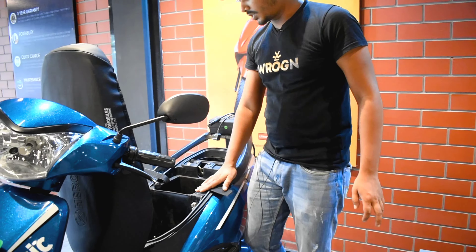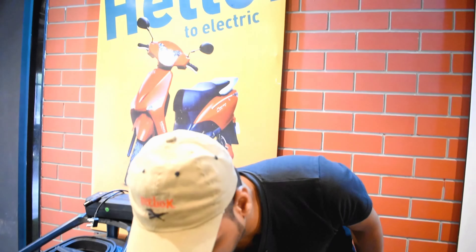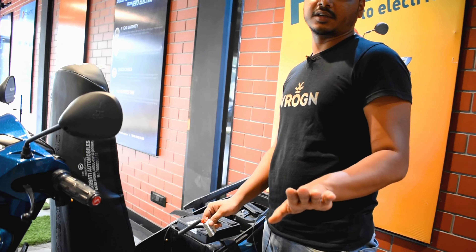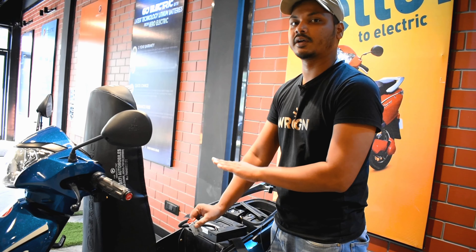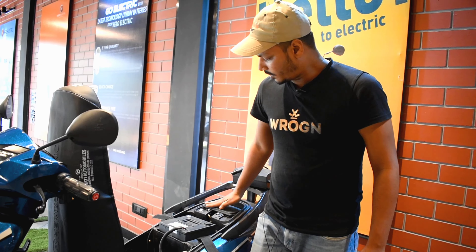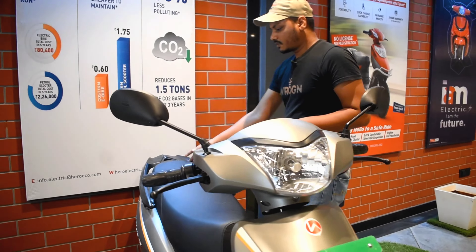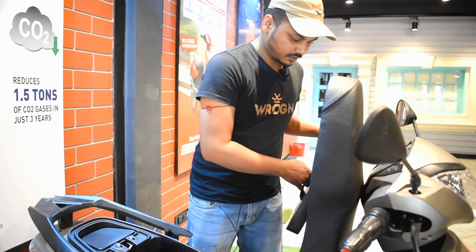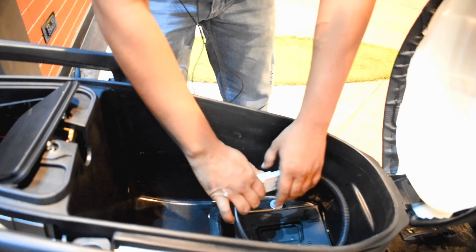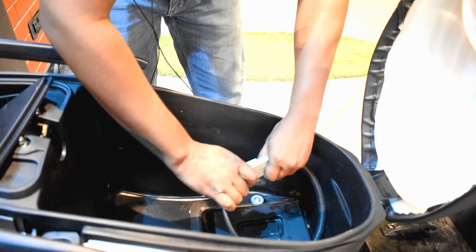The same process applies for your B1 battery — you can disconnect it the same way. After the battery is fully charged, you have to attach it back. You have to switch the MCV off, then reconnect it. After connecting, switch the MCV on. This is the process for the CX-ER dual battery. For the single battery, it is the same process — MCV off, charge it, then reconnect and MCV on.